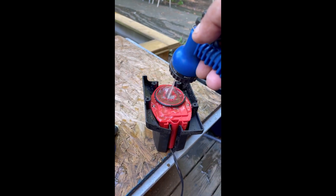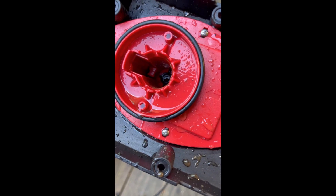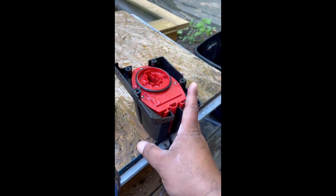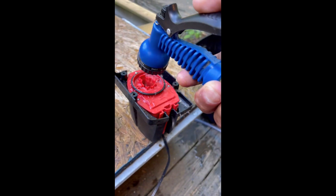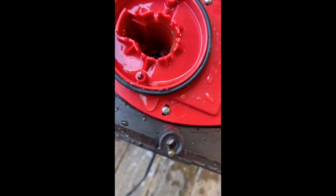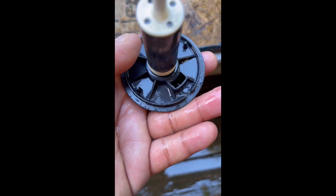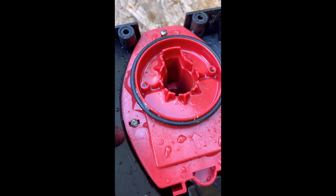Once it's all apart, I basically take the hose and spray lightly inside the chamber. I don't know if water all over the motor would hurt it, but I try my best not to spray too much water in there. The whole object is just to get the gunk out — if there's any sand or anything like that, it'll come out once you turn it upside down and pour the waste out. When you put it back together, be careful: there's a little square notch and you have to make sure the impeller lines up exactly the way you took it out. There are also two little plastic things and two holes that have to line up perfectly.